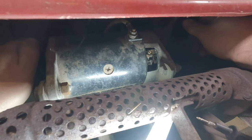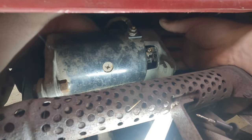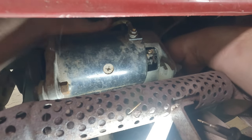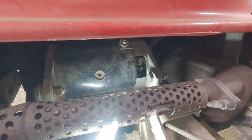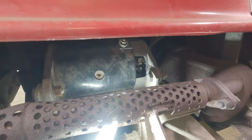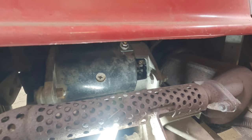The brushes look fine — no wires broken off, no melted terminals. Turn the key back on — see how it's moving freely in the carriage. I'm wondering if we have a bad starter generator. What we're going to do is take the starter generator out of the cart and see what happens.